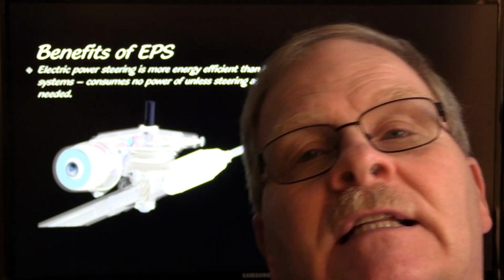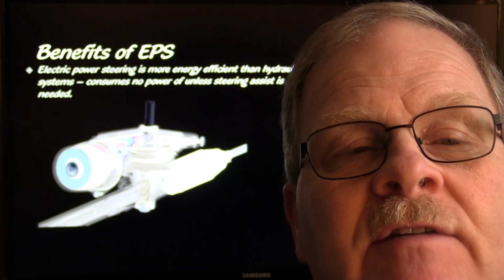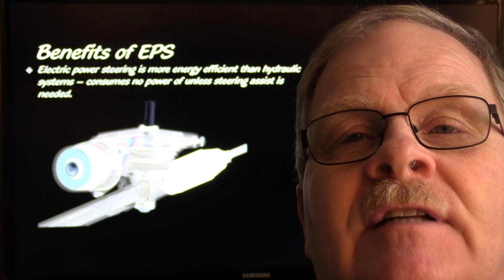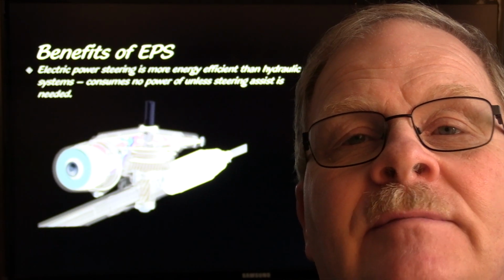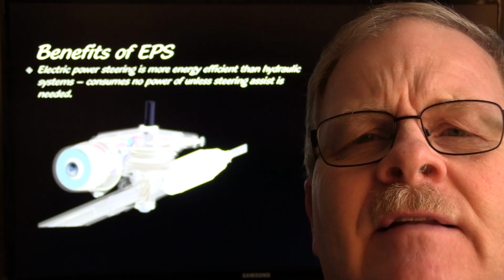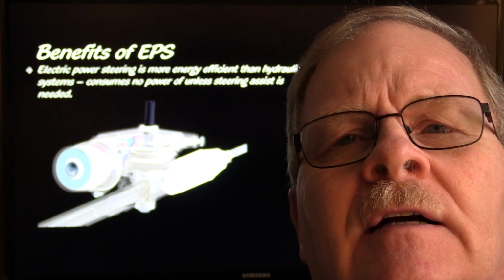Of course, I will tell you this, it will pull some pretty serious current. On my wife's pickup, she's got a 2016 F-150, I put my scan tool on it and I turned it against the locks a couple of times, and it pulls some pretty heavy amps. Getting up in the neighborhood of nearly 100 amps, about 80, 90 amps if I remember right. Now, I've slept since then, but it was pretty high amperage whenever you turn it to the locks.